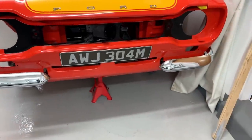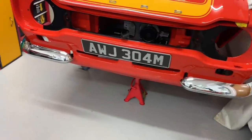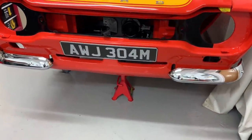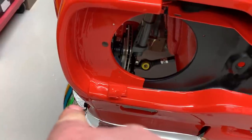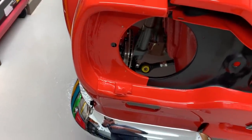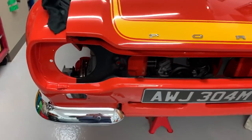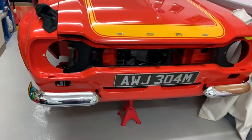The other little job I've done today is fit the quarter bumpers — absolutely beautiful fit, no issues at all. They fit exactly how they're designed to. Just something worth remembering: there's a bolt that comes through from the inside, so it's always worth touching up those bolts. On the outside I've touched it up with black paint so there's no bare metal. On the inside, under the inner wing, I've painted the bolt head orange just to stop it corroding. I've used stainless steel washers and stainless bolts where I can, just to prevent corrosion.